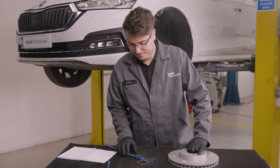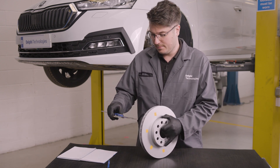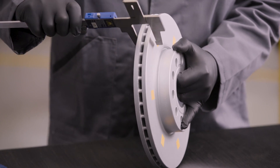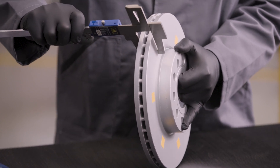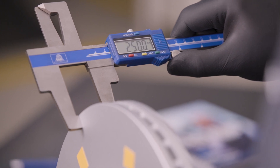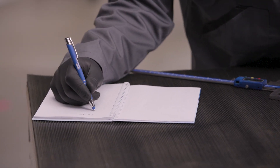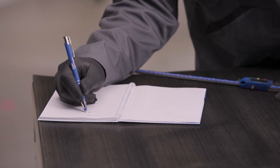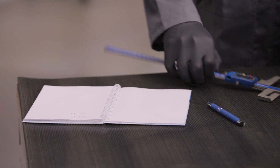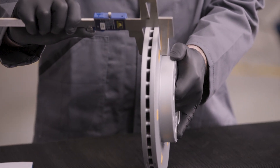This is a brand new Delphi brake disc. If I measure the thickness of this disc using a vernier caliper face-to-face, the reading is 25 millimeters. I can also find out what this value should be from the manufacturer's technical data — in this instance it matches perfectly. To accurately work out the DTV for the disc I need to take several measurements. I've marked this disc to illustrate the point, but you could just use a paint pen or a marker to remind you of where you started.